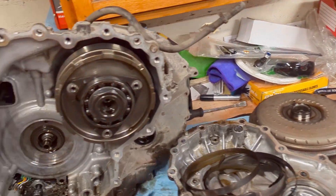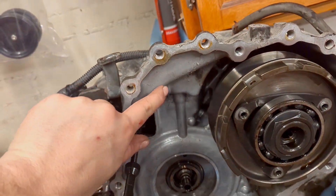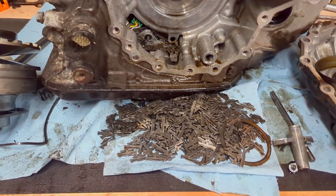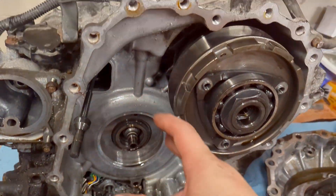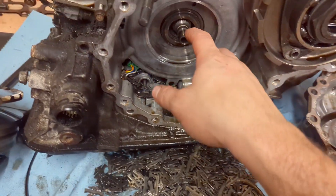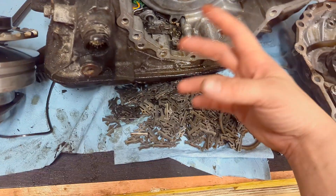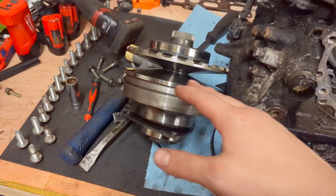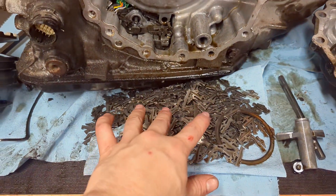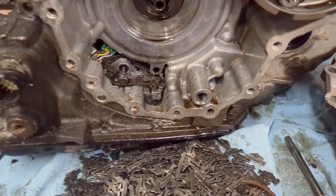So just as I thought, I had a no-move situation in the transmission. I'd put it in gear and just didn't hear anything happen. Basically what's happened is the straps here — the bands that hold the CVT belt together — broke. So when this pulley would spin, it would just spin and not transfer any power. The reason it's been making sounds is because this pulley is very slippery, and these links would just stay in the bottom of the tranny and not make that much noise from inside the cab.